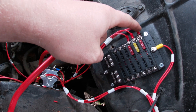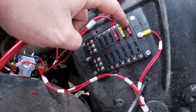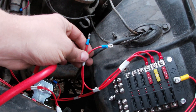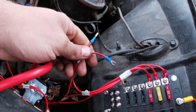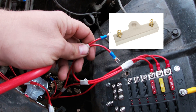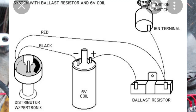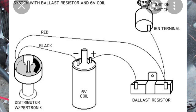The first circuit is all positive. I put a 10-amp fuse on it — I believe this first one was my ignition. This wire runs straight to the coil — actually it runs to the ballast. Whenever I turn the key on, I have power to this wire and it's going to plug into the ballast: 12 volts in, out of the ballast at 6 volts, and it goes to your ignition coil so while you're running your car you have spark out of the coil going down into your distributor.